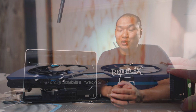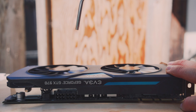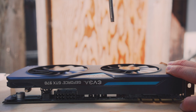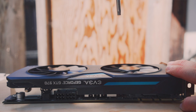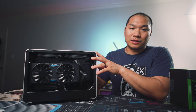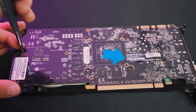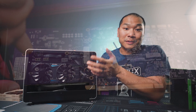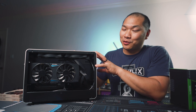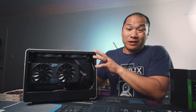The other thing I'd recommend, even though it doesn't necessarily have an important thermal impact, is just to blow the dust out of the card. From a maintenance standpoint, it's good practice, and I think now this GPU is good to last through another few GPU shortages. I don't think you have to repaste your card every year, but do check it every now and then. If you're concerned about warranty void stickers — which is a debatable issue depending on your locale and jurisdiction — just wait until your warranty expires. Typically a two or three year run on factory paste is perfectly fine, but I wouldn't wait six years.